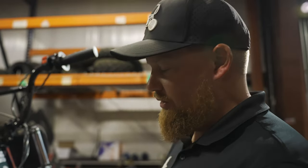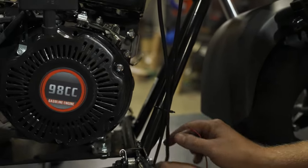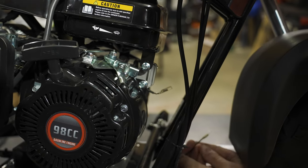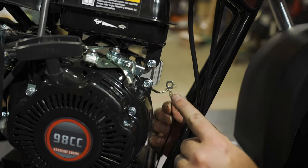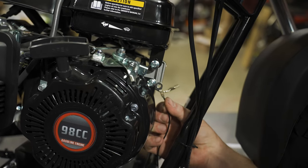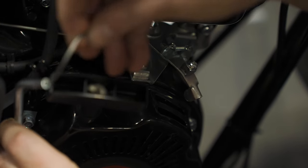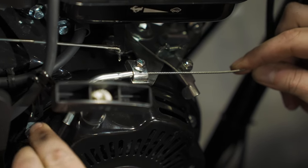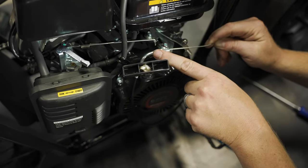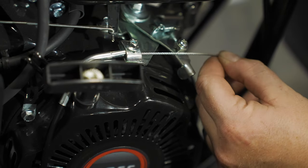The last two things I'm going to show you are how to hook up the throttle cable and the kill switch. This kill switch — you will hook your red wire into the wire coming off of the engine, and then your ground you're going to put in between the shroud and the engine block by taking this bolt out, putting it in there, and then tighten that bolt back down. The throttle cable is just as simple — route it up this way, try to keep it nice and round with no sharp bends in your cable. Bring it down and around, clamp the housing in here, your cable runs through, and you tighten that down.